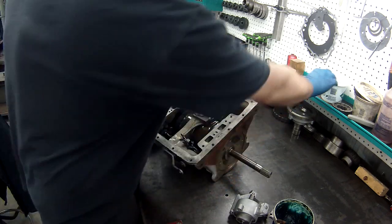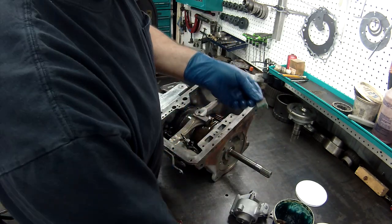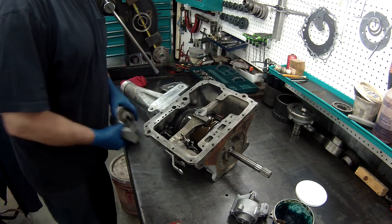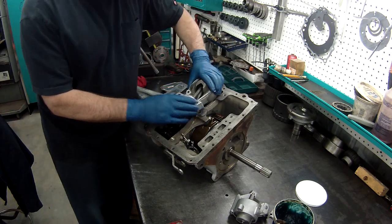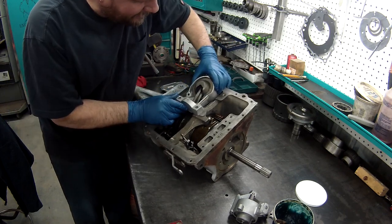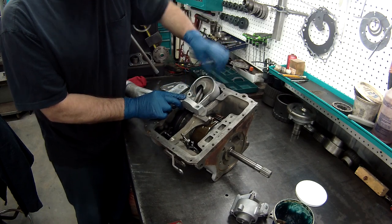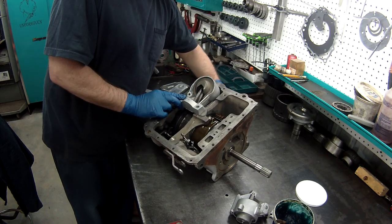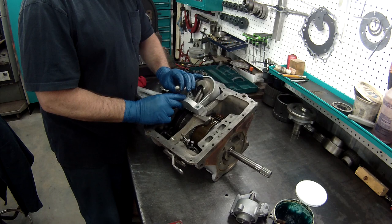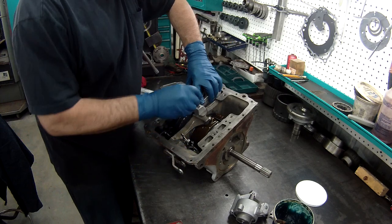What I do is take my other band little strut here and put a little gel on it to kind of hold it in place. Kind of hold it up. So when I put this in, I can watch to see that it's getting, and I can see if I'm pulling that up, it's moving the band. I want to adjust the band up a little bit so I know, and get my bolts. This is the center support one.